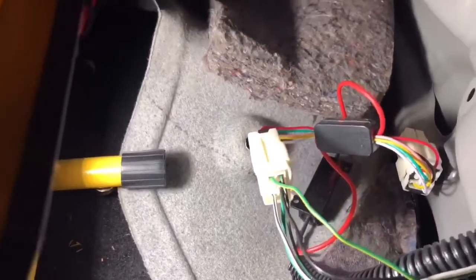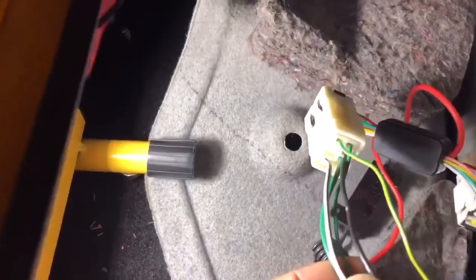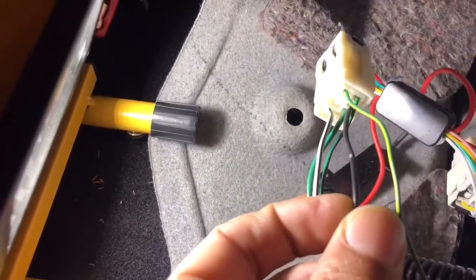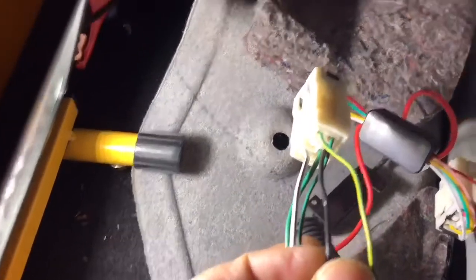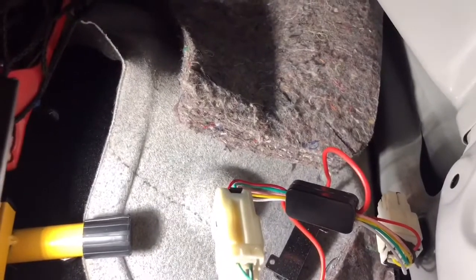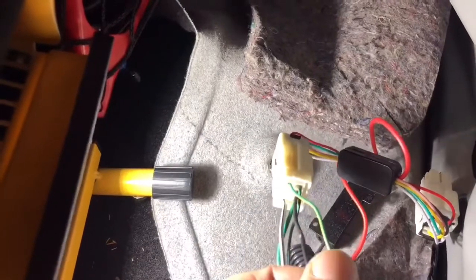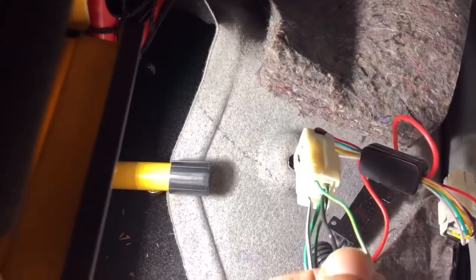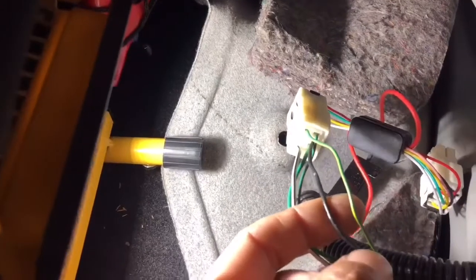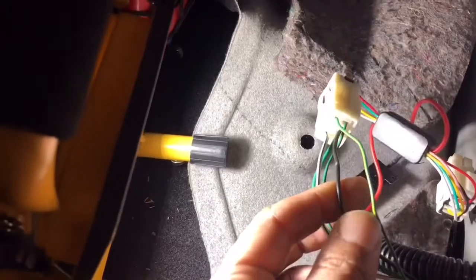What's up y'all, we're about to do the blinker mod. So if you're a G37 owner trying to do the blinker mod, cut this wire here — green and yellow — and this black one. I've also got the Turner's tail bolted in there too, so this is going to be the first time I'll see if I can tap into this and still run the Turner's tail and run the blinker mod at the same time.